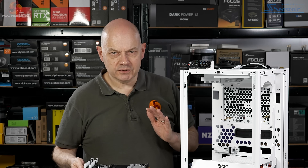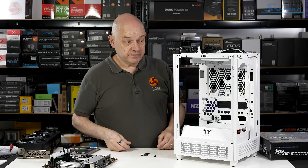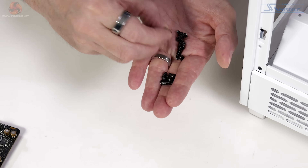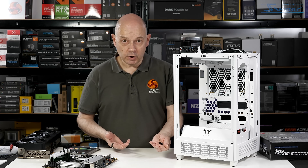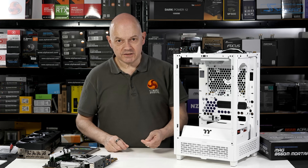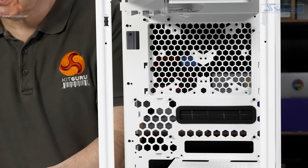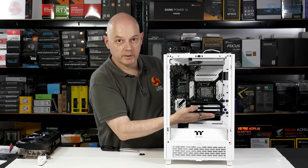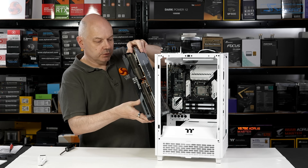How can I install a Micro-ATX motherboard in a Mini-ITX case? The explanation is straightforward — this is actually a Micro-ATX case. We have the correct holes in the motherboard tray, and in the accessory pack we have a stand-off installer, extra stand-offs, and extra motherboard screws. With the graphics card clamp removed and the extra stand-offs installed, we can slide the motherboard into place. With the motherboard secured, we can install the RTX 4080 graphics card.